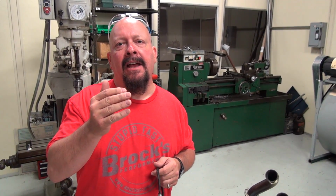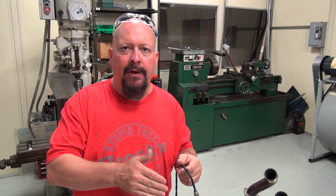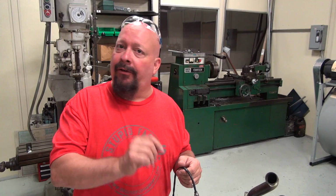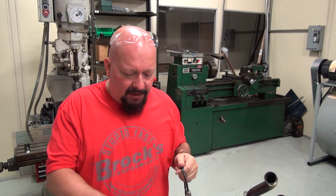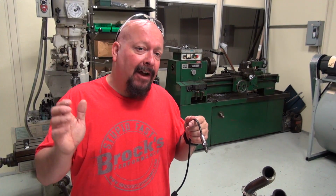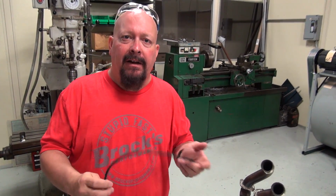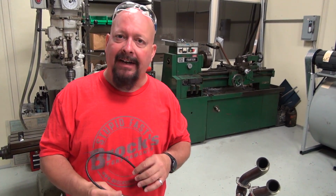So it's taking the ratio of air fuel that you're using, and it's leaning it down at cruising speeds only. At wide open throttle, this isn't even on. This is only for cruising speeds. It's only for emissions. Now, we have customers that care about the environment. They want to run these, and they want to run them with their stock ECU.